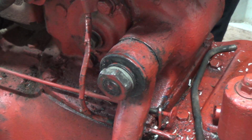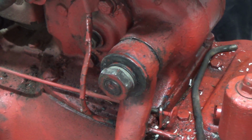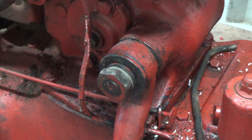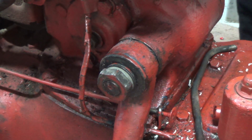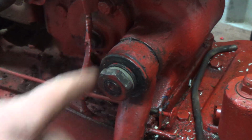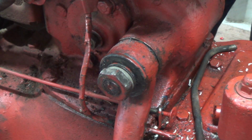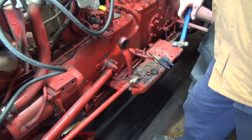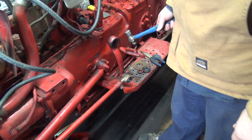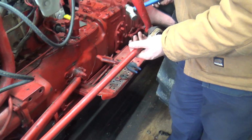And this is moving the front. This is what happens when you drive. So it's definitely got a worn out spot in there or something. That's tight onto the thing there, but there's no spline or taper left in that, I don't believe. Boy, I hope it's that and not the actual shaft. Okay, someone put new joints on here. I think they were thinking that that's what was worn out, but unfortunately it's not. I'm going to see if I can get this off of here.